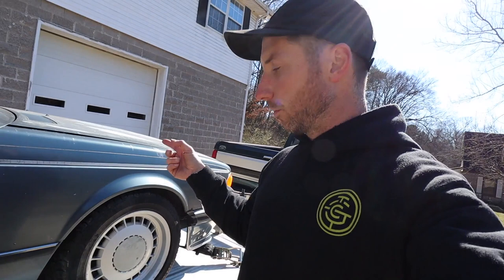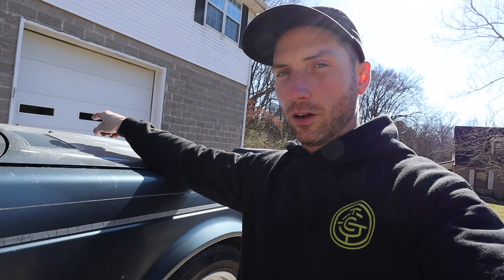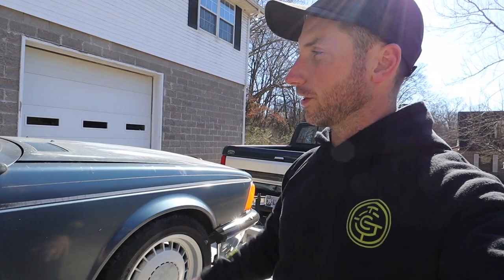I do know there's a water jacket on the left side of the block that runs from like cylinder 1 to cylinder 5, apparently, which is a giveaway for the M90, as well as an L painted on the driver's side, the left side of the block. So I haven't been able to put eyes on an L or the water jacket yet. We definitely will when it gets out to Sutton's in California. That's when we'll know for sure if this is an M90.